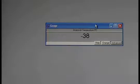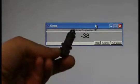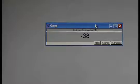So if this number, or if we saw voltage on our scan tool, changed when removing our sensor, then you know the sensor's bad. You're pretty much done, actually. You can do some of the other tests that we're going to do, but you would be pretty much done.